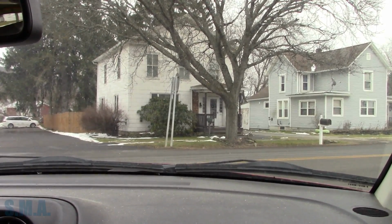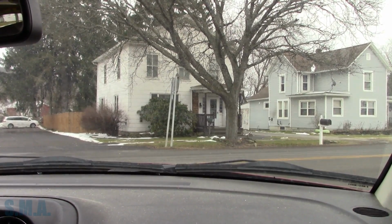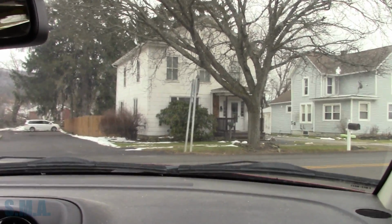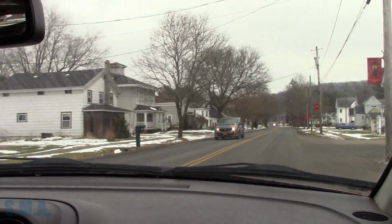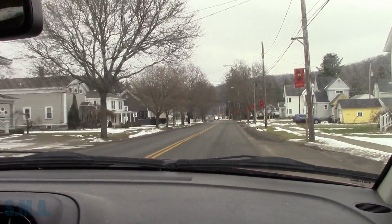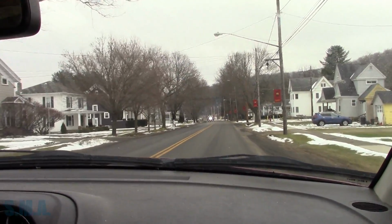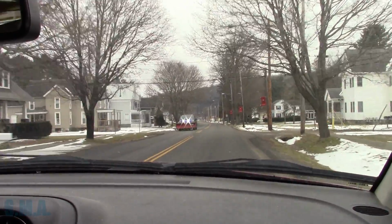My seatbelt is on, just so you know. It's the brake. Whoa. You know what works better, fella? When you put it in drive. It's the brake light flashing. All right, hang on. Pop's got you. And right now we have no right front wheel speed signal at all. Right front is at 0, zippo, and now the left front just dropped out.